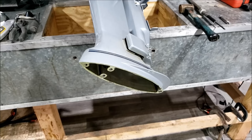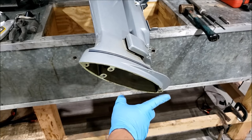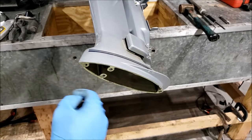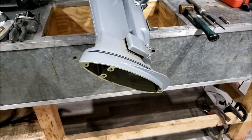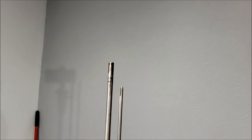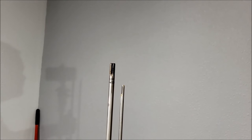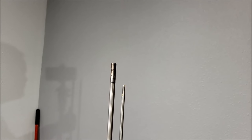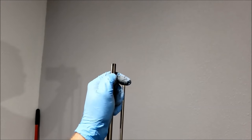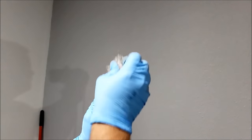Here are my concerns thus far. Granted, those were painted together — there's no doubt that the paint was doing a little bit of sticking and holding. The green phosphor primer and the paint on the lower probably stuck itself together, so I'm not going to fault them for that. However, once that was free, it was still a bit of a pull to get this out of there, and it really shouldn't have been. The drive shaft has just a pinch of grease up there — it is old already. You can already see the rust forming inside of the little splines. That shouldn't have been a thing. I got a little piece of steel wool to clean it up.